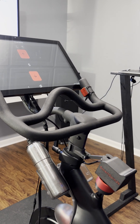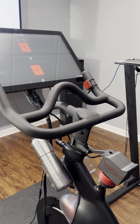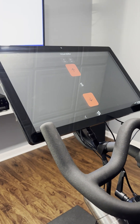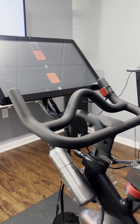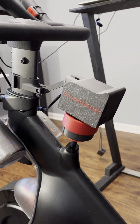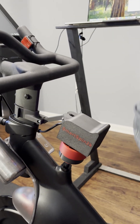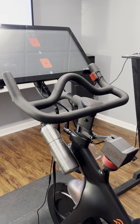Once homing is complete, I'll shift this up a couple of times. Now, what happens when we repower the SmartSpin 2K? Once power is lost it no longer knows where it is, so we'll simulate that by selecting reboot SmartSpin 2K. Once it reboots, it detected that I was pedaling and now it's seeking to find the lower position, then shifted up again. Normally, as soon as you start up your SmartSpin 2K or re-plug it in, you just want to pedal just slow enough that it detects RPM and it'll go through that procedure automatically.